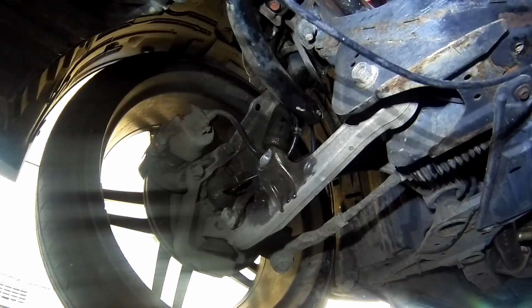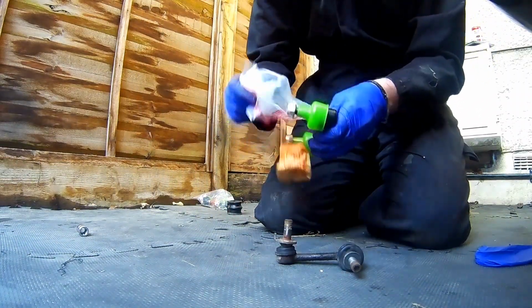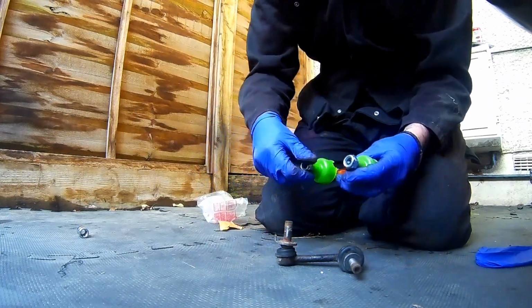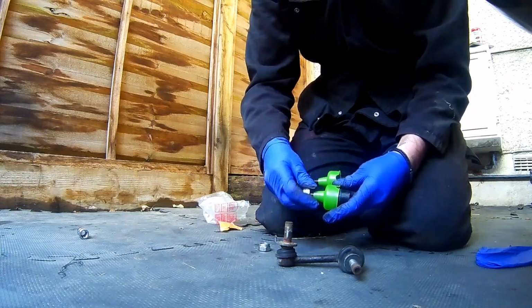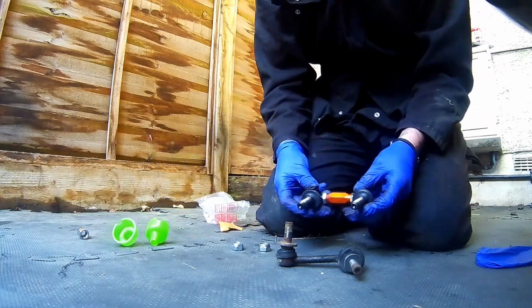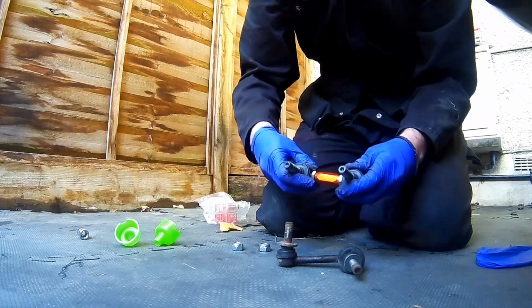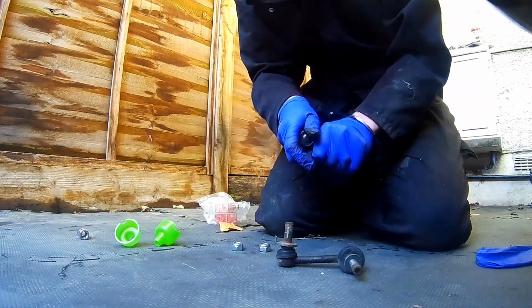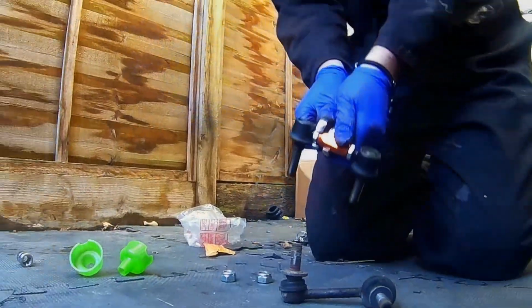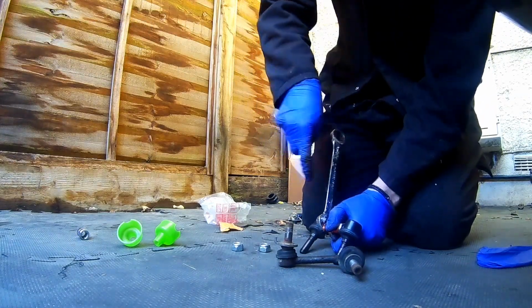So that is the driver's side drop link off. Original drop link. Now what we're about to change it for. So this is the Jap Speed adjustable drop link. Okay, so the wonderful thing, these have got bolts on the end, so you can see you can hold it still with a bolt. Okay, so you can see the reason they're so good is once you undo that bit, two 17mm spanners, you've got to undo the lock collar. I'm doing it the wrong way, look.